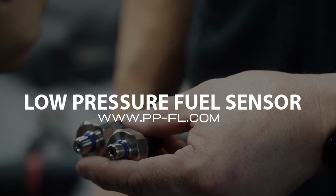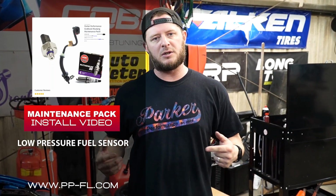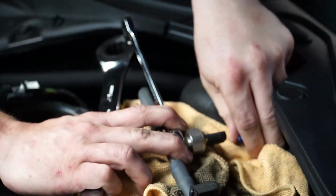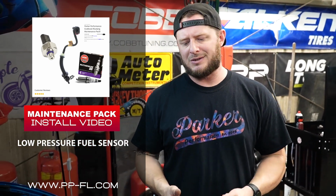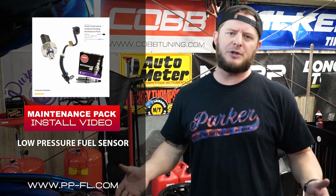One of those is the updated sensor with a low pressure fuel sensor. This has been a long debated topic as to whether or not it's an issue. Look, it's a cheap insurance policy to go ahead and replace it now as opposed to finding out that it failed and you have an issue later. So we recommend replacing it. It's a $60, $70 part, something like that. It's not an expensive insurance policy.